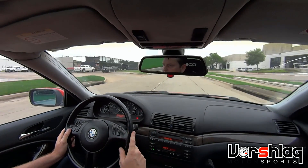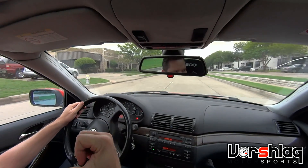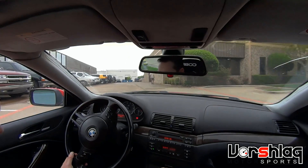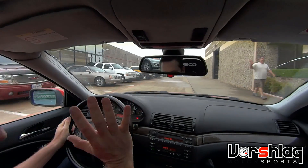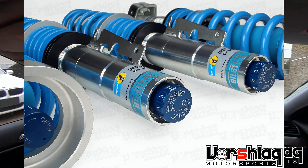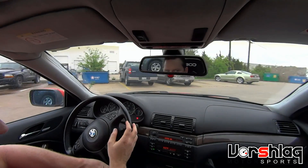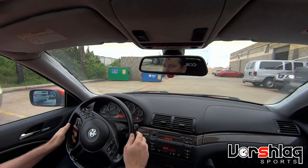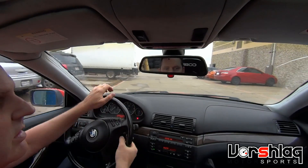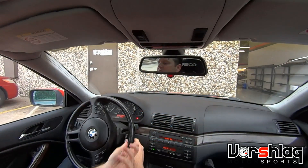Amy drives this every day — no complaints. A little jolting. I would say that E46 you just drove rides better, right Brad? That's the PSS 10 setup, and that's got more spring rate. It's effectively the same dampers but they're adjustable, so you can turn the damping up to deal with the higher spring rate. The PSS 10 is probably the better choice for a budget coilover setup that sees any street and track use. Take the springs that come in a Bilstein kit and throw them right in the trash — they are too soft.